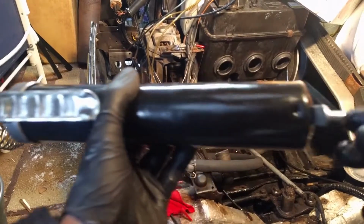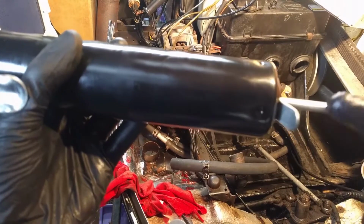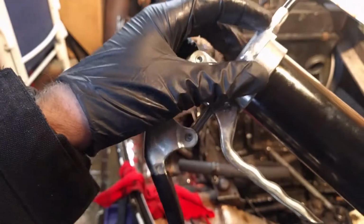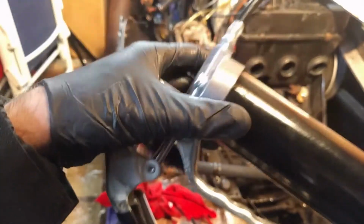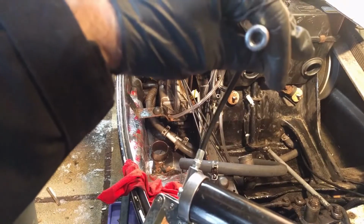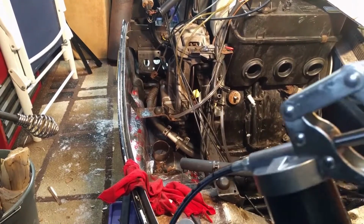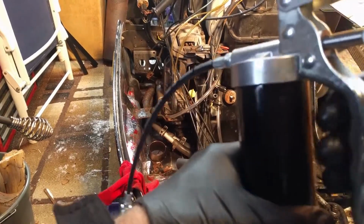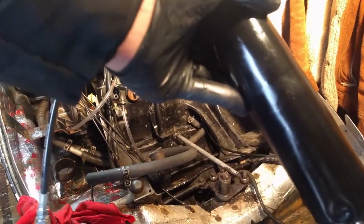But since this is loose, that means your plunger's spring activated trying to go up, so that's what's giving you pressure. And then as you pump on this, you're opening a seal here, I'm guessing, and that's what's allowing the grease that's being pushed that way to come out of your fitting. So we're just going to get the grease flowing, so we're going to give it some pumps until we see grease coming out the end, because you don't want to be pumping on it while it's on the zerk fitting without the grease being ready to go.